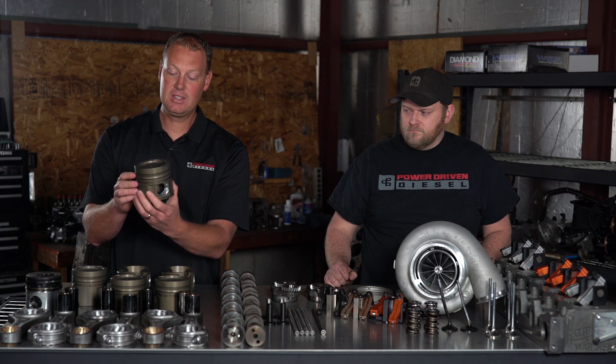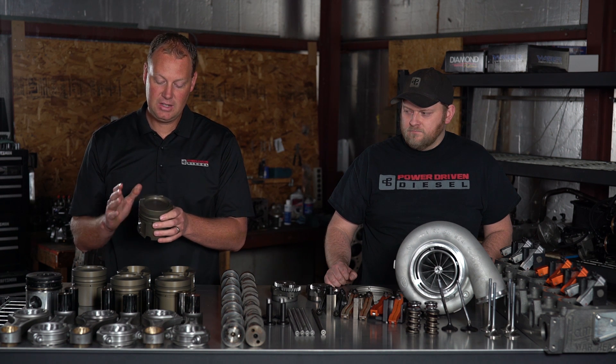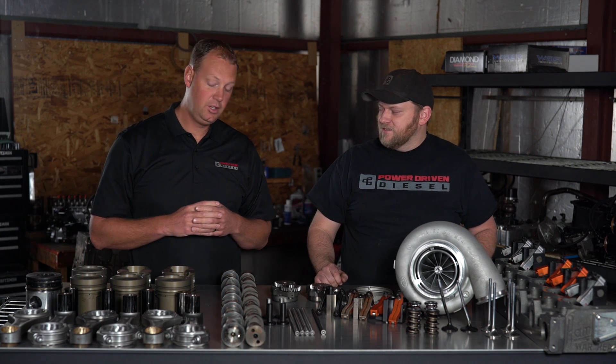They have different ring lands. The reason this piston is not silver — it's anodized. It's hard anodizing on this piston, which makes it a lot stronger. So this piston is what we're going to use in our big build for the UCC. Now could you run these anodized pistons on the street, in street engines? You wouldn't want to.